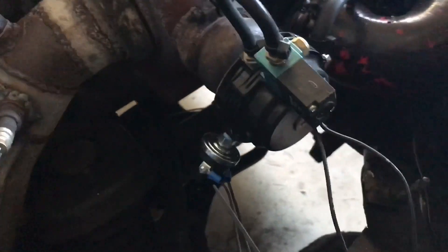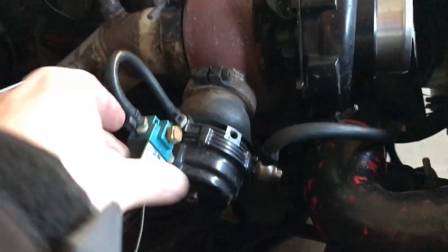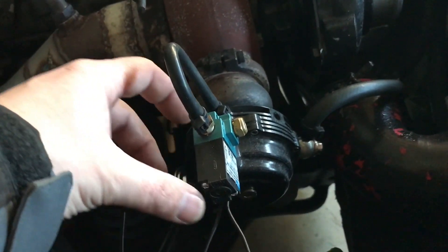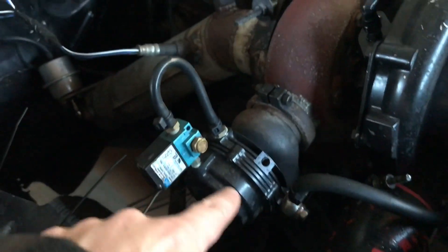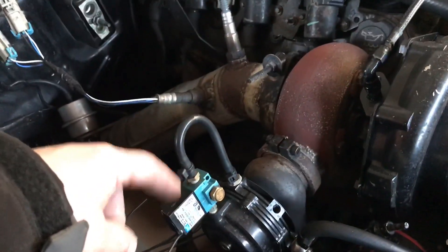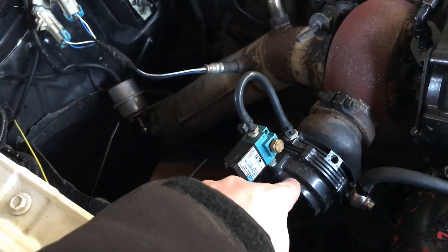It's completed again. I don't have anything loomed, obviously — still testing everything. That's what we say to ourselves when we don't loom things. But there's the pressure switch. So at 1 pound it lets this guy get control. You can have the boost controller set and it won't beat up the solenoid, and it'll kick on. A lot of people ask isn't this too much heat — I've had these guys in engine bays where it's pretty disgustingly hot for a long time and they work fine. I figured I would do this because it would be simplest and cleanest, and a lot of people might understand how this works better with how simple this is, instead of lines over here, solenoid over here, vacuum lines over here. People seem to get confused, but it's literally that simple — you're just adding pressure and pushing back down.